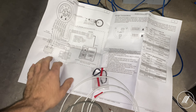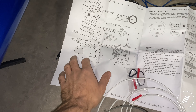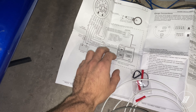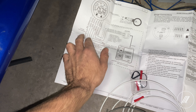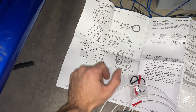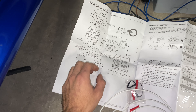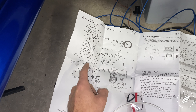I'm extending all the lines I need and looking at a diagram. For the air fuel ratio gauge — all the gauges have the red wire which is power, fused with a 5 amp, and black is ground. I'm going to tie all the grounds and all the power together, with individual 5 amp fuses going to each gauge so if one gauge blows it doesn't take the whole system down. I'll share the ground across all three gauges. So far the second gauge is pretty similar to the oil pressure gauge.